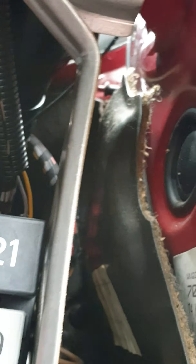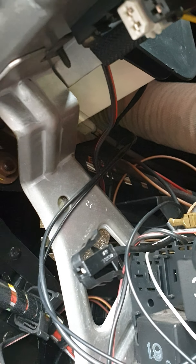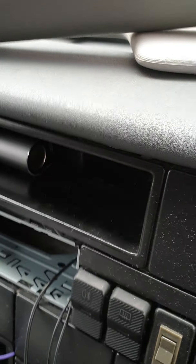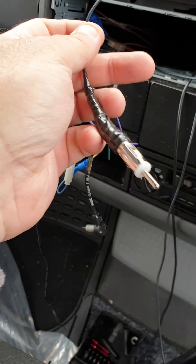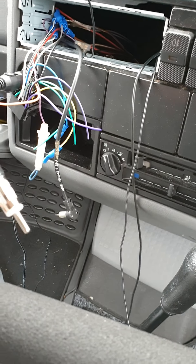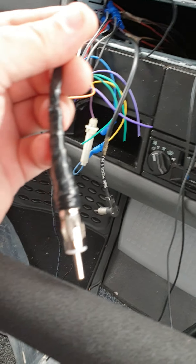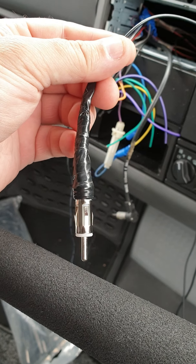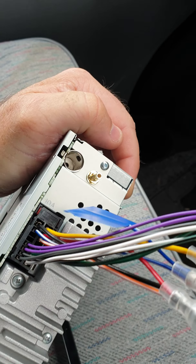It runs down from up there, round there, round the other back. Because this is an old T4, I've got a DIN connector, which is for the DAB antenna power, which will then go into the back of where the aerial is, because the DAB needs 12V according to instructions.